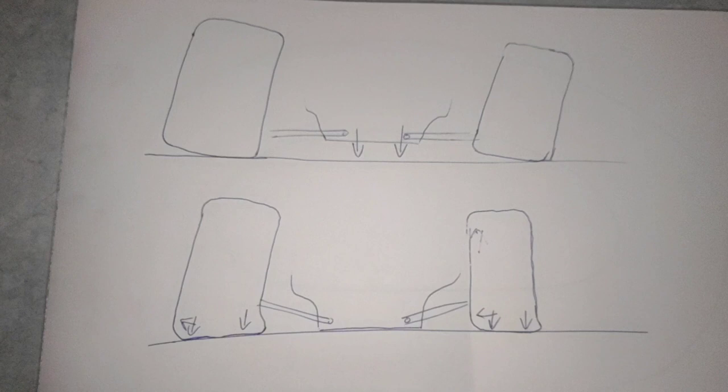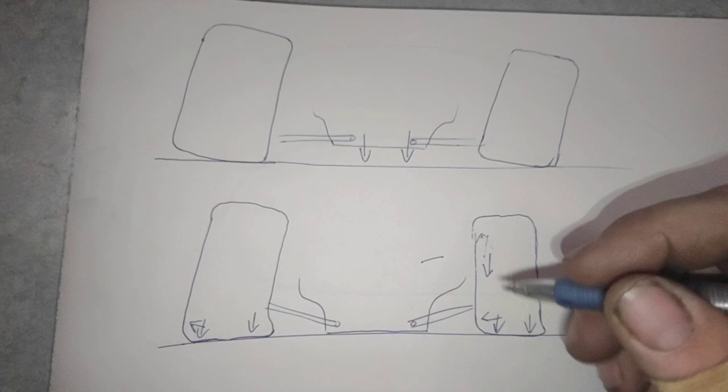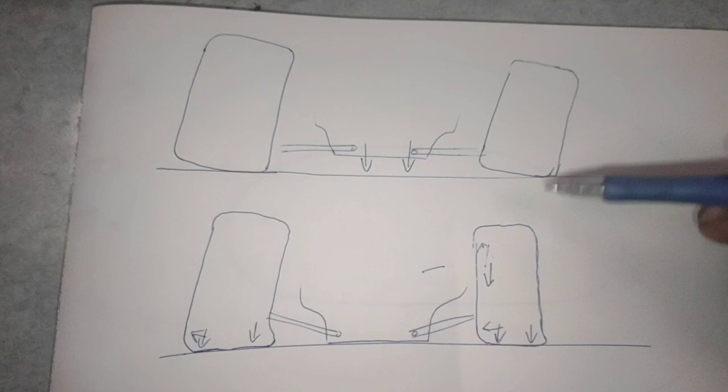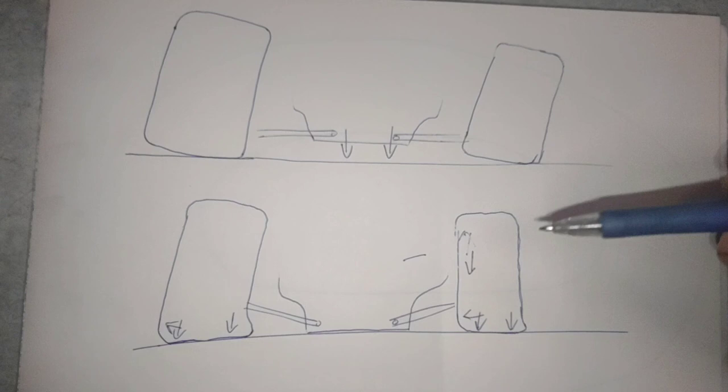By having a bump stop and stopping this car at its travel, you're able to keep that weight on that left front. You're able to keep that car digging through the corner, and then it relies on its shock from there. So if you're not allowed to have bump stops, bump springs, typically a roll center is going to work better for you than jacking forces. If you're allowed to run bump stops, you're allowed to run really aggressive shocks and springs, you can get away with the jacking force, but it's all, like I say, personal preference.